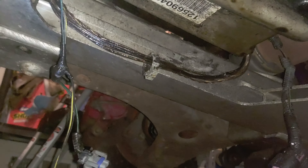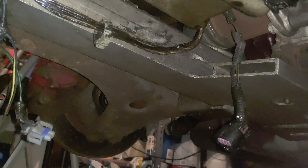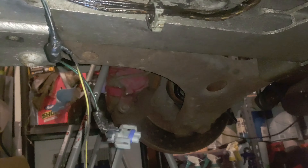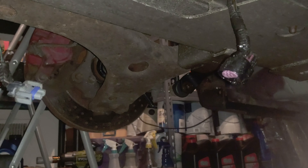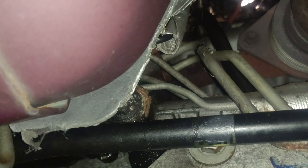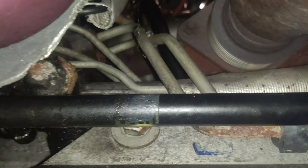I'm going to be looking at those mounts to see if I can come up with something different, similar to what I did making poly mounts for the 3800. Right now I'm disconnecting the entire harness - you can see a lot of the loom has crackled away and some clips will need to be replaced. I'll be disconnecting the wheel speed sensor wires that go down the control arms, then disconnecting the ball joint and the sway bar, so I just have the cradle with the control arms and engine/transmission. The steering rack with its plumbing and the magna-steer system I'm going to try to leave hanging.